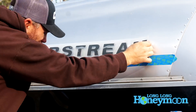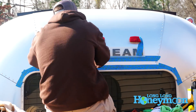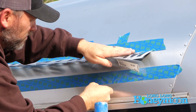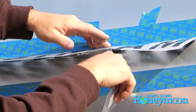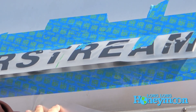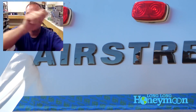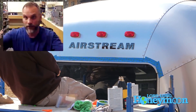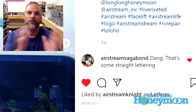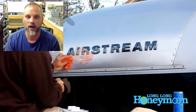The new badges come with an adhesive protector on the back and a transparent plastic cover over the lettering - and the lettering is already spaced out evenly and lined up perfectly. I used painters tape across the top to hold the whole emblem in place, then flipped it up like a door hinge to remove the adhesive protection on the back, flipped it back down, and mashed everything down good against the side. Then you peel off the protective coating on top, revealing the letters that are nicely evenly spaced and straight. The cost on those logos is somewhere around $200 each - so it's a $200 sticker you don't want to mess up.